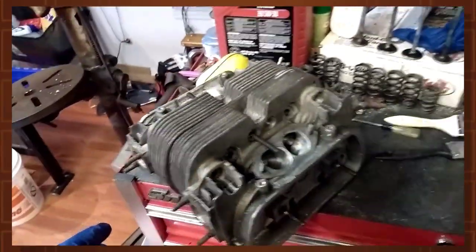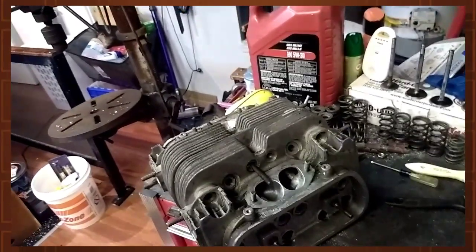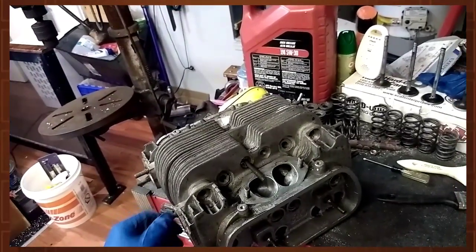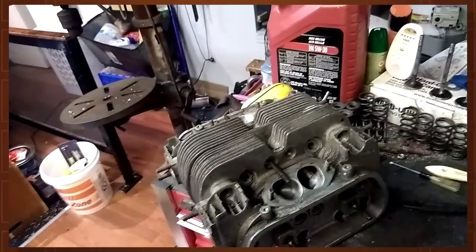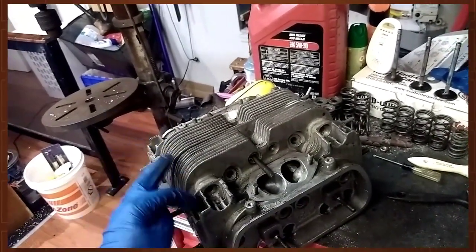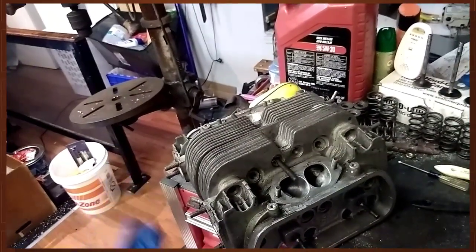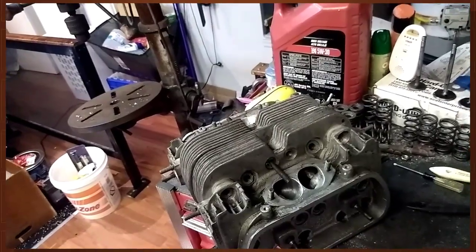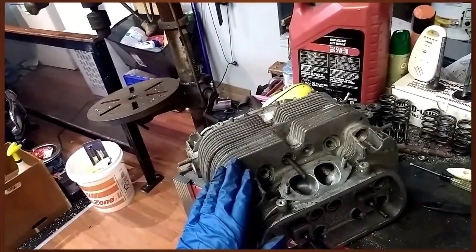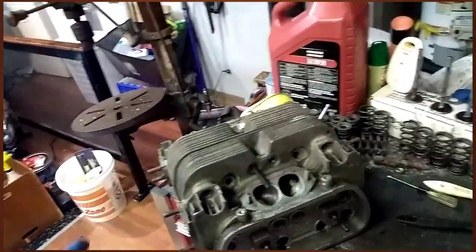Hopefully that gives you guys a little idea of some of the things you're going to have to take care of if you buy aftermarket heads. Like I say, it's not really brand dependent — pretty much most of them are that way, though a few brands are better than others at cleaning the casting. Get your drill bit out, drill through those holes, and make them as clear as possible so air can flow through the engine — because if air is not flowing, it's not doing anything for you. Anyways, don't forget to like and subscribe, get out there, get your projects going, and God bless y'all.